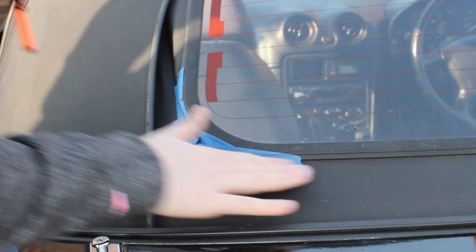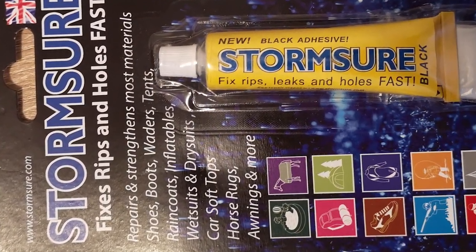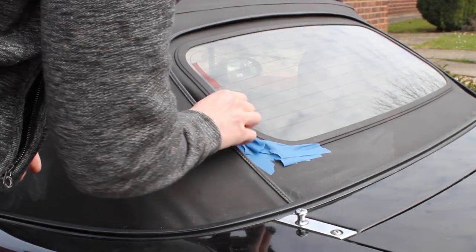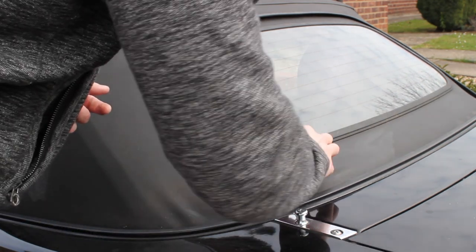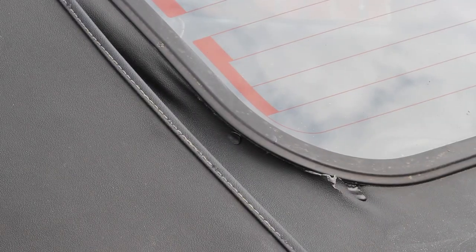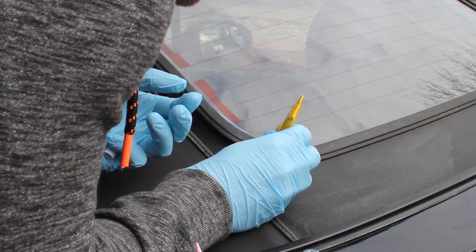The reason I'm doing the inside first is I didn't want to push the material out, which is why I'm taping. It's a black material and it did go on quite goopy — it's not very pretty. You could perhaps maintain a better finish by going with smaller amounts and more passes. I didn't have too much time so I just wanted to get it watertight. This is what it looks like after the first pass from the inside.